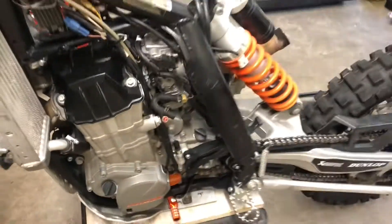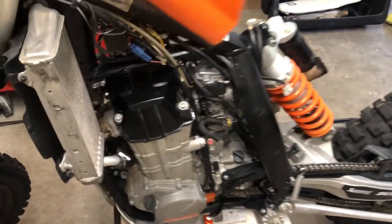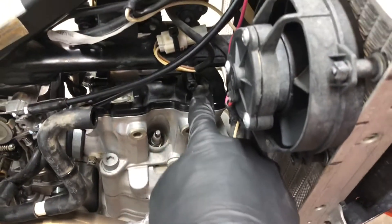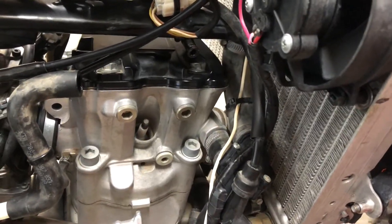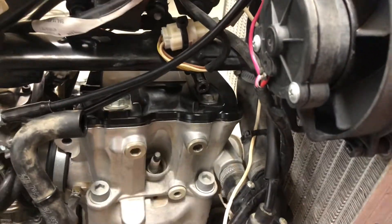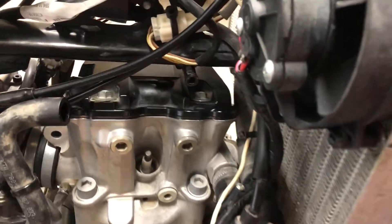The procedure, once you've got the tank off and all this stuff stripped off — I've got more off than you really need — is to take out these valve cover bolts. There's four of them. I think that's going to be the hardest part of this whole procedure, but they're just kind of tucked away. I've already taken off the pad on both sides that the tank sits on, just to give me more room. Here are the other two bolts for that valve cover.